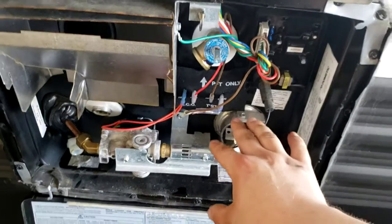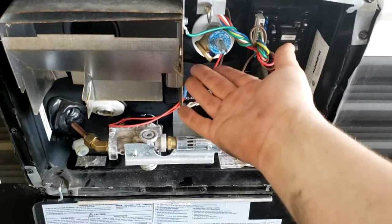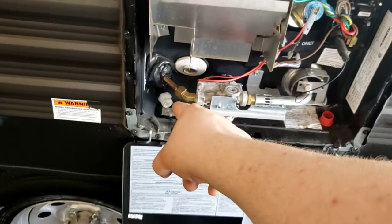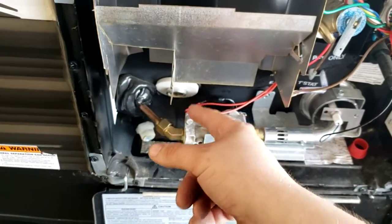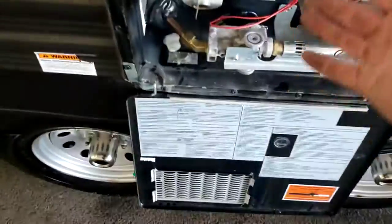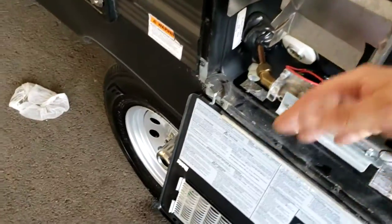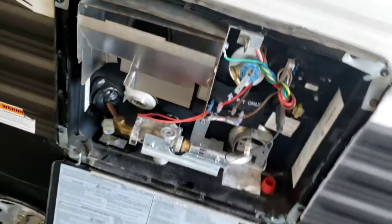That's fine. Everything out here is designed to get a little bit wet. Once the water stops squirting out, and sometimes it's just air that comes out, snap that closed, and then you can take that plug out. If you neglect to do this first, when you take that plug out, you're getting a bath. And you can see it's right at the level to get wet. You don't want that. Even standing to the side, you're going to get wet if you don't relieve your pressure first. So make sure you do that.